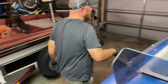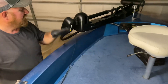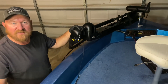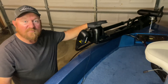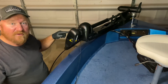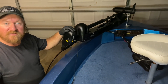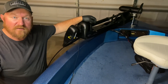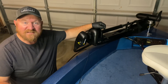I've done a couple of videos on upgrading your trolling motor plugs that you can check out, and I've also done some trolling motor repair videos, but I haven't mentioned anything about the circuit breaker — so I just wanted to make sure to cover that. You can look up your trolling motor model number on the manufacturer's website. For Minn Kota, they'll show you the amp draw, and that way you'll know what circuit breaker you need and what amp-rated receptacle you're going to need for your boat. Thanks for watching — please like and subscribe.